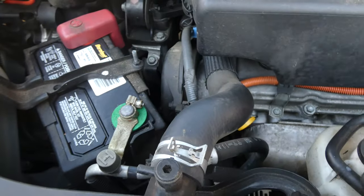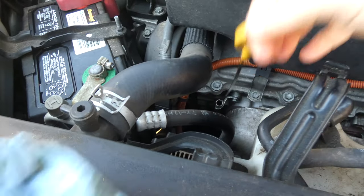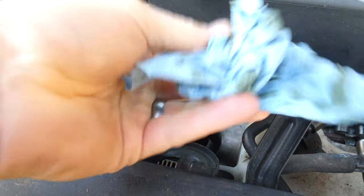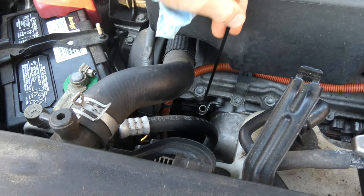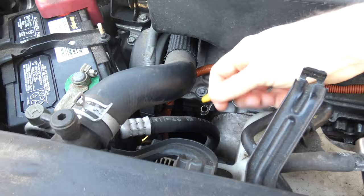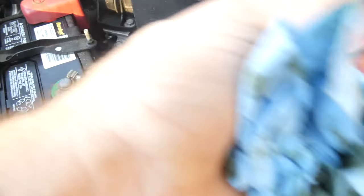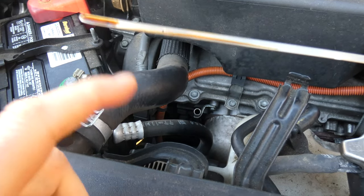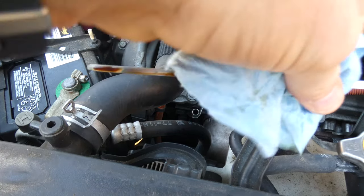Here's another vehicle. In this case you'll see the dipstick is in a completely different location. I'm going to reach down here and do the same procedure — clean it off with a lint-free cloth, then reinsert it making sure it goes all the way in and your fingers aren't in the way. Then remove it and read the level on the side. This one is safe — it is between the bottom dot and the top dot. We are at safe level.